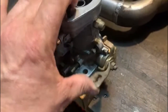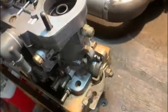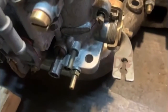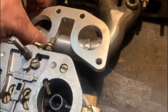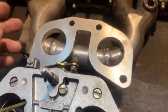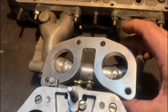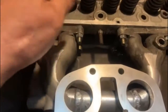To make it simple, I want my throttle cable to work easily, so I'm going to put a normal Nissan 1400 throttle link on there and a little bracket. In other words, this carb will sit there somewhere and I'll make a bracket for the throttle cable so it must look like it's supposed to be. So this manifold and flange of mine will be there, and I must get it aligned and everything and then it'll be welded on there. The engine sits at a slant in the car, which means this side of the manifold must lift up.